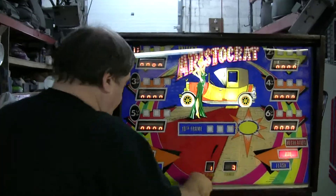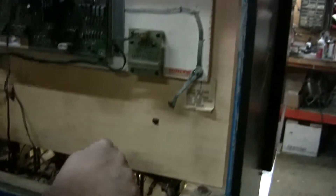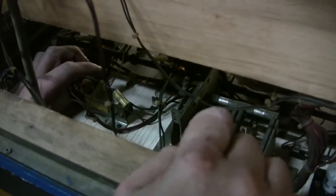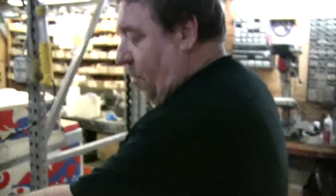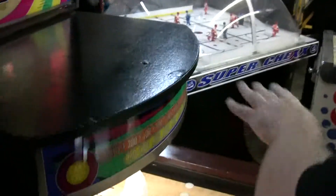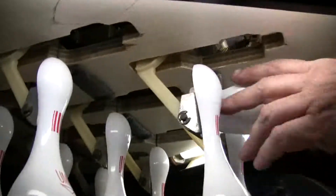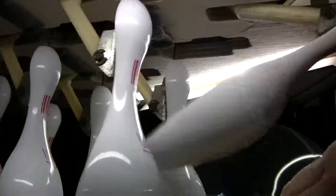Back here — Frank, come back here. We've put new capacitors on the sound board. We've also done a lot of work on the reset board — the panel inside. You can see the motor spinning here and going in. We've actually taken that whole board out and washed it. The top and bottom surface has got the screw on it. We have two new fluorescent lights. And then we've put new rubbers up top where the pin swings up and bounces into it, so it's quieter.